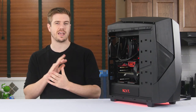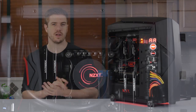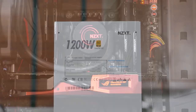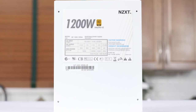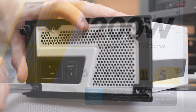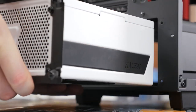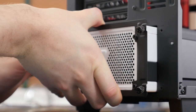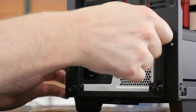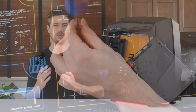Folding at Home and BOINC don't really care much about RAM, so we didn't go quite to the overkill level here. If we were building this PC solely for distributed computing, even 8GB would have been enough, but we went with 16GB of HyperX Fury DDR4 modules. For the power supply, NZXT hooked us up with the 1200W Hale 90 V2, which will ensure we won't run out of power even under heavy load. The power supply is white, which doesn't quite go with our aesthetic, but it hides under the fantastic included basement compartment in the case.